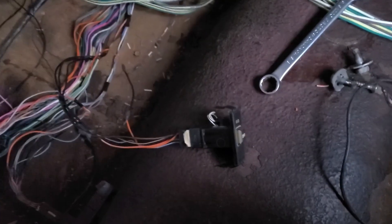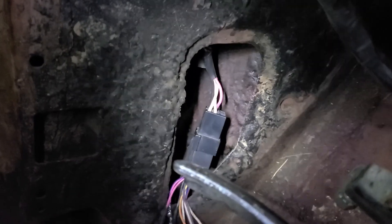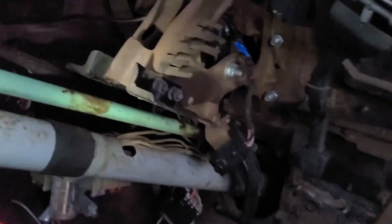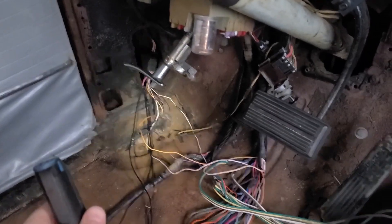It's the next day and I got the overdrive switch done. I forgot to show it, but they both fit in there well. There's also another connector over here for the brake lights, so I did that really quick. In total each wire is around 18 inches. I managed to get over into that little cubby hole so the brake wire can come across from the brake switch and go straight over — it's fairly out of the way with no weight on it.